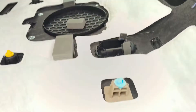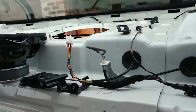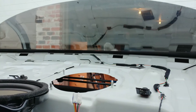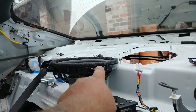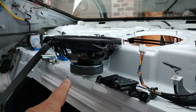We were using some plastic pry tools to carefully get under these pins and lift that up. This is literally just snapped in there and it's got some tabs in the very back that go into those square holes, so it'll snap back in. Then you'll find some 10 millimeter bolts on these four studs to remove your subwoofer.